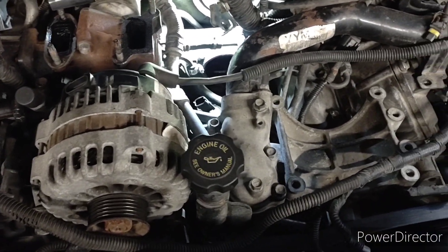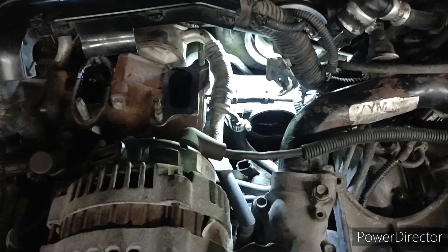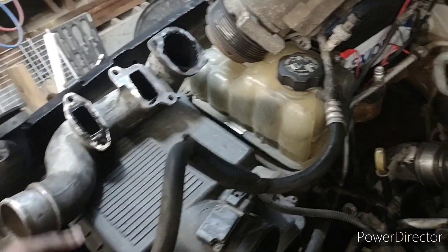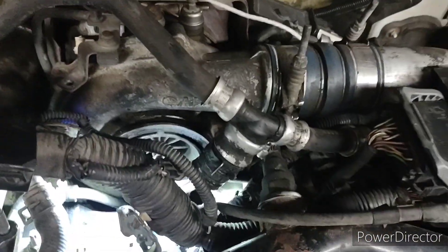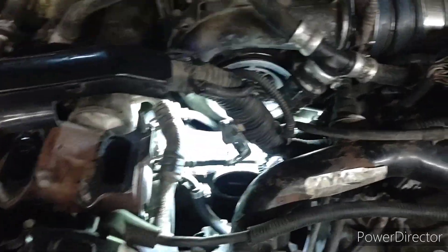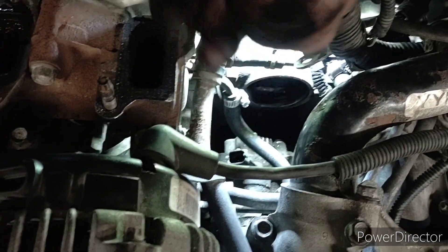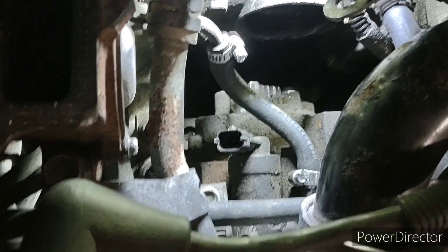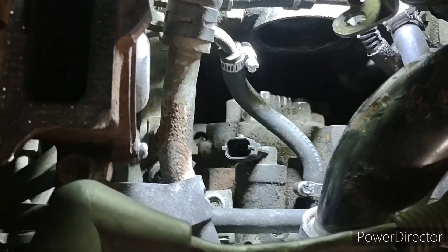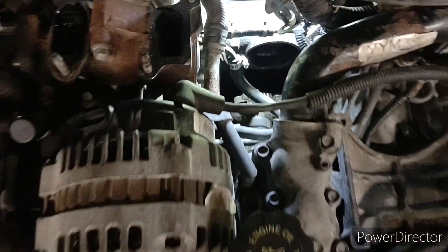It may be slower — took me about a half hour to get everything off. AC compressor, take off your EGR — here's the AC compressor, your intake that goes to the turbo, and the other part of the EGR that goes under your bridge. I just stuck a screwdriver down there and twisted it, popped it off — gives you the fuel pressure regulator right there. Three T25s, so I'm gonna continue getting those out.